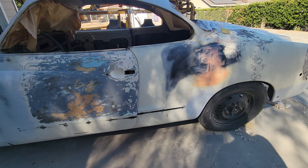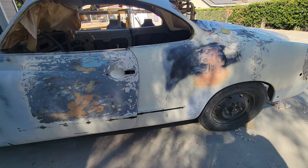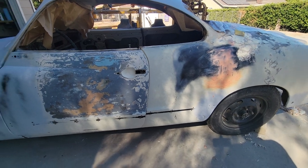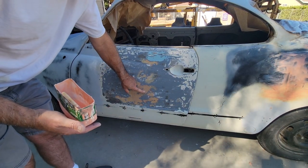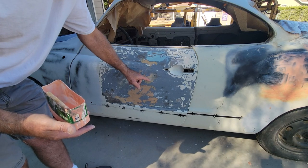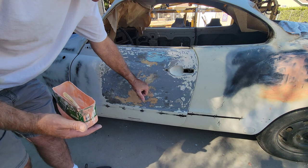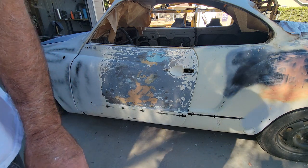It's like an old Maaco or one-day paint job, and underneath that is the original paint. This stuff does soften the original paint a little bit, but it doesn't just wrinkle and take it right off — it'll take off any previous paint jobs on top. Looking at the bodywork here, there's some filler that's not regular Bondo and it didn't want to touch that as well, but most regular fillers like Bondo or other polyesters it takes right off. The primers it didn't really want to take off, but they sand really easily, so it's actually working out well for this project.